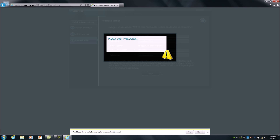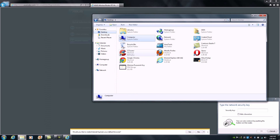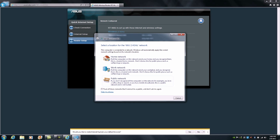At that point it will automatically update this information directly to the RTN66U and reconfigure our wireless network IDs to have new names. It's let us know that the SSID has been changed, so this may require us to reconnect. We're going to go down and select '66U 2.4 GHz', and using the security key we previously referenced, we'll connect. We can see that this information has now been successfully stored.